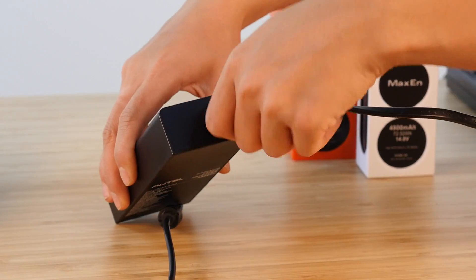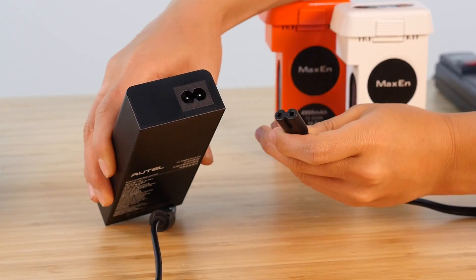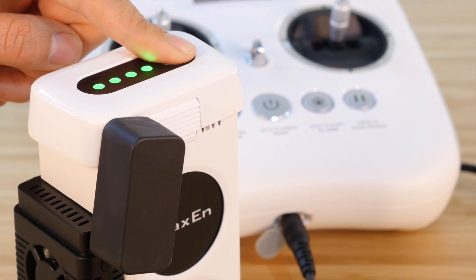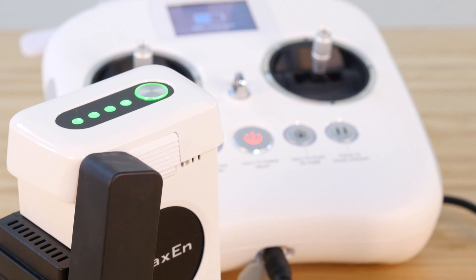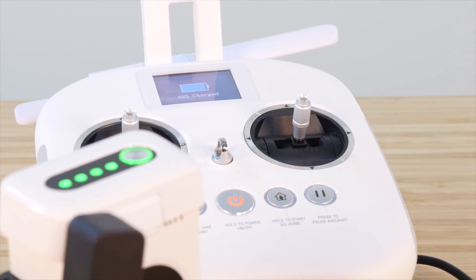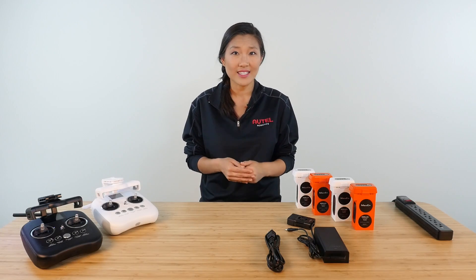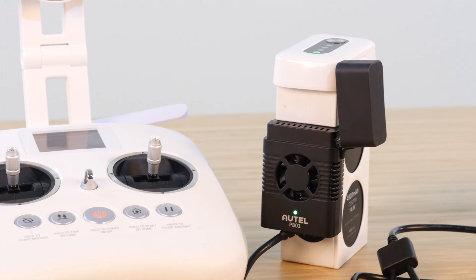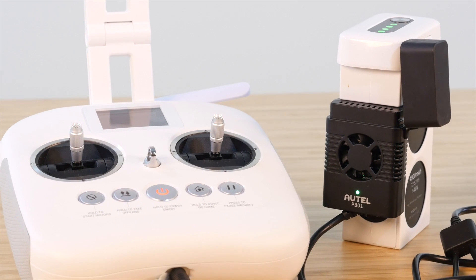All you need to do is disconnect the AC cable from the brick and connect the battery and controller to their respective plugs, power the battery on, and you'll see from the controller's LCD screen that it's charging. Be careful when doing this, though, because it drains the drone's battery and you never want to discharge your drone's battery below 5%. Doing so can damage or shorten the life of your battery, so just make sure to keep an eye on the drone's battery level. I'd recommend taking both off the charger before the battery reaches that last LED light.